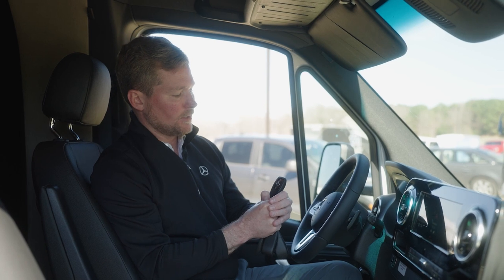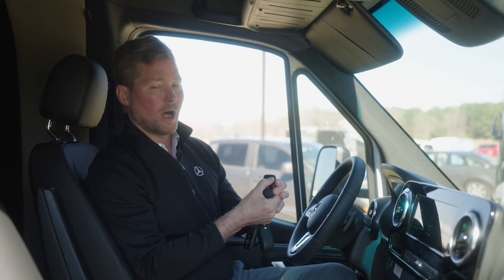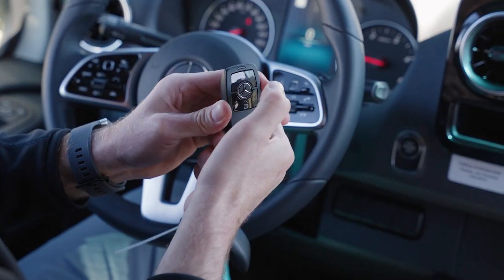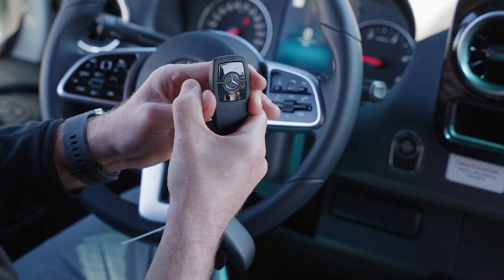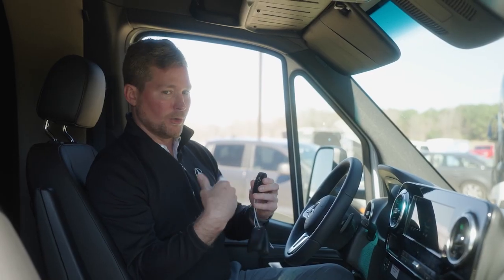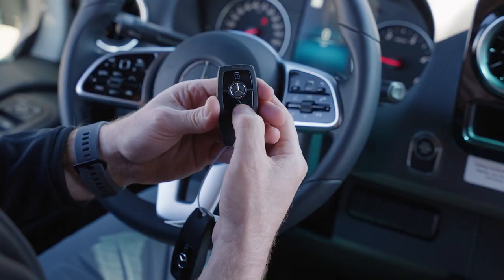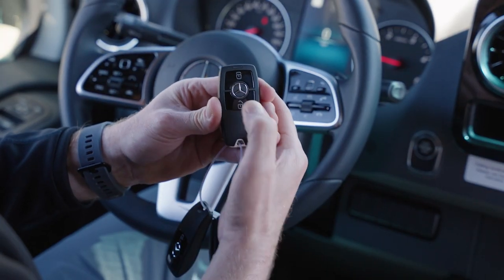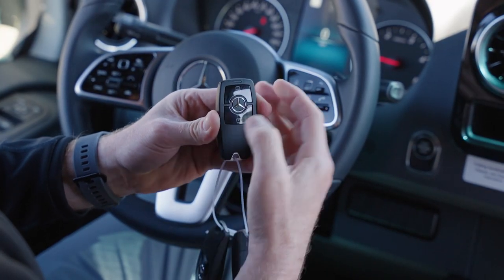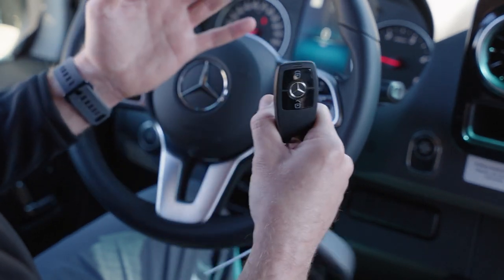If we're parking the coach for an extended amount of time and we want to save battery life, you can go to your lock button and hit it twice in rapid succession. You're going to see the light come on — I've just put this key fob to sleep so it's not communicating with the vehicle, reducing your battery life. To wake it back up, simply hit unlock in rapid succession and you'll see the light flash twice on the top of the key fob and your key is awake.